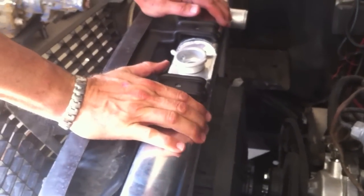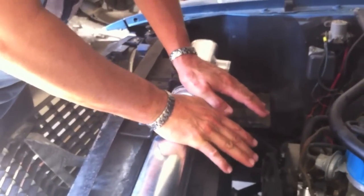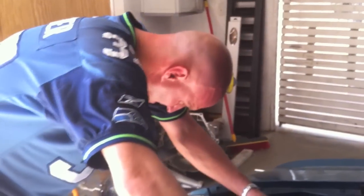I just put the bracket on and I'm looking at the pinch quality — I'm not happy with it. It's got movement. So I'm going to take this bracket back off and bend these down a little bit more so they put more pressure down on the radiator to hold it firm in place. I was able to bend the bracket so that when it clamped down it just locked right in on the radiator. Now we're good to go — the radiator fan has been installed. There she is, all snug, not moving anywhere. There's the electric fan and there's the clearance between the water pump pulley.